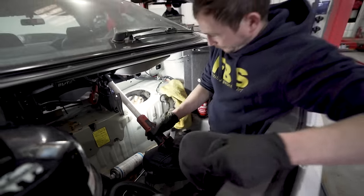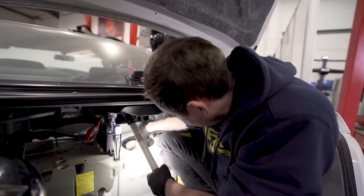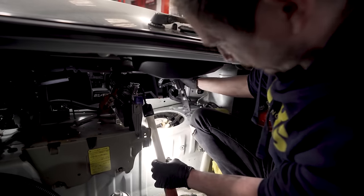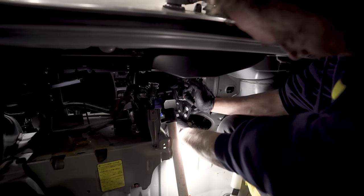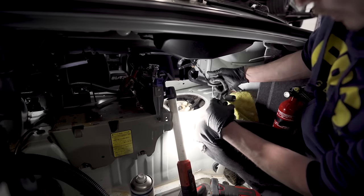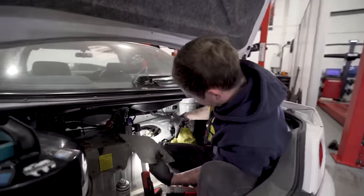Let's see what shiny goodies we have. Blimmin' heck, lad, that is tight. So, fuel pipes are sat on, and we got some very nice single ear clamps because I hate those Jubilee bloody things everyone uses. So we literally just, yeah, much better. Looks factory as well, doesn't it? Just gotta make sure you get them in the right place before you squeeze them up, like so. Nothing's loose, that's fine. Right, dear boy, there is a metal plate under here. Feed through like that.